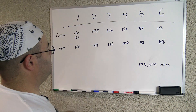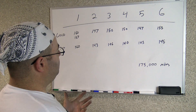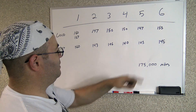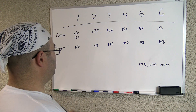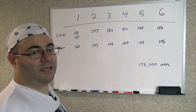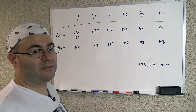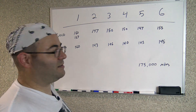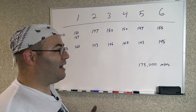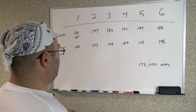These are the numbers I'm seeing. I was honestly hoping for better. 146 is the minimum — you can see in some cases we're getting below that. This engine's pretty tired, although honestly it doesn't feel tired at all. It's still very fast and I don't really notice many problems driving-wise. Then again, I haven't owned the car since it was new, so I'm obviously leaving a lot of ponies on the table and I don't even realize it.